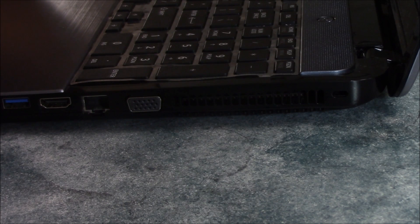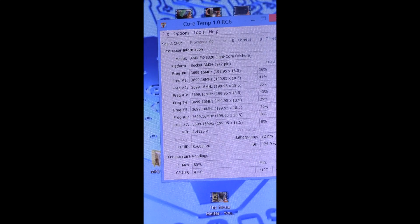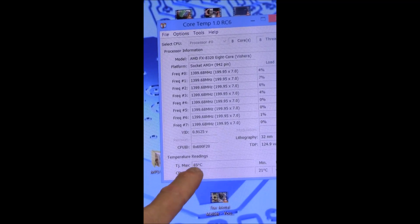So what I'll do is strip down this laptop and see if there's a reason for it overheating. One program I use quite a bit is called CoreTemp, and what it does is give us an indication of how the CPU temperature is going. We've got a maximum of 48 degrees and a minimum of 21 degrees at this point. The maximum it's allowed to go in this case is 85 degrees. At the moment the CPU is running about 27 degrees, which is okay. I'd recommend CoreTemp if you're concerned about the temperature of your computer — it's a free program.